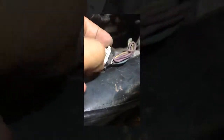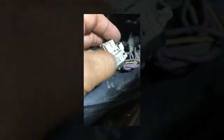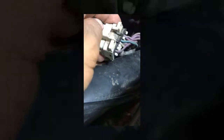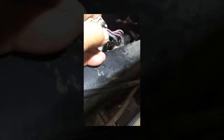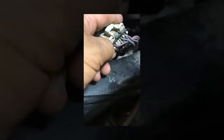This here is the connector in question. The little locking tab that goes in here broke off and the harness is breaking apart. Basically this side of the connector is not making good contact while the other side is. One of the locking tabs is broken off this one, this one still has it. Going to reuse this case and these pins with the exception of two that are broken inside, and replace this little locking tab - the small black plastic piece in the back that helps hold it in place.